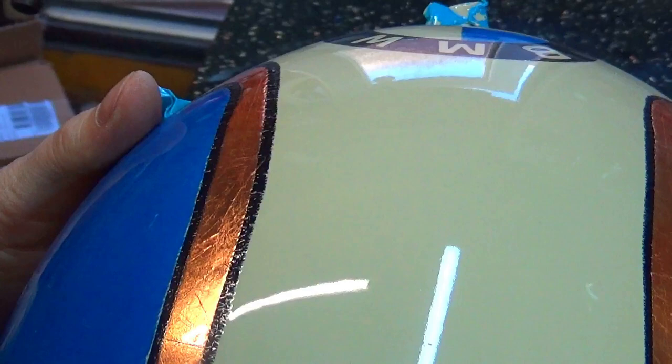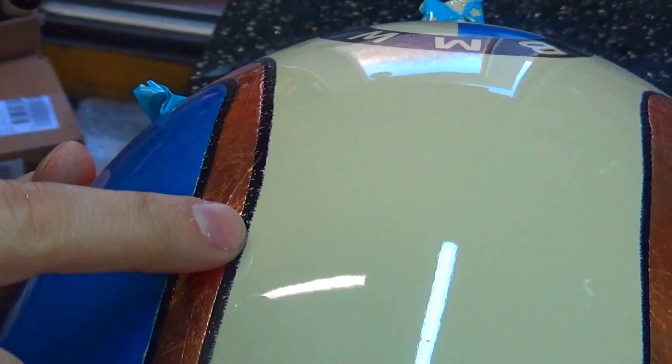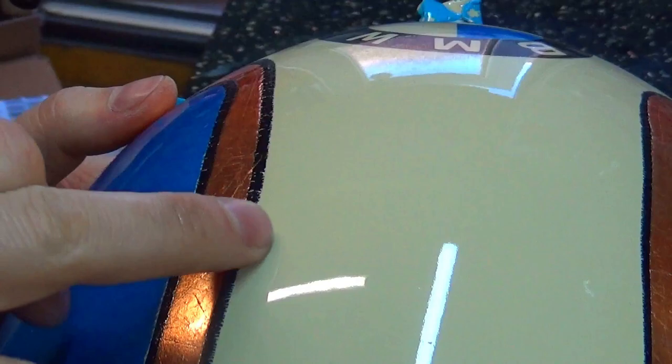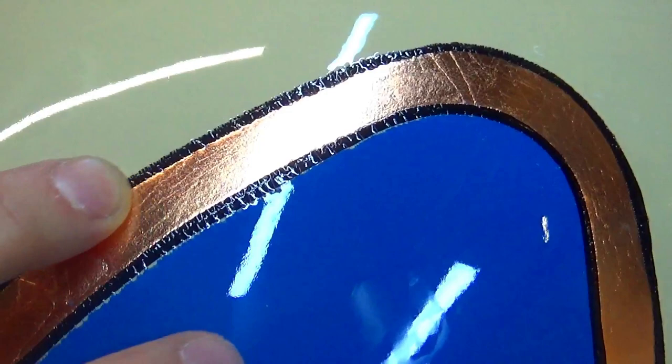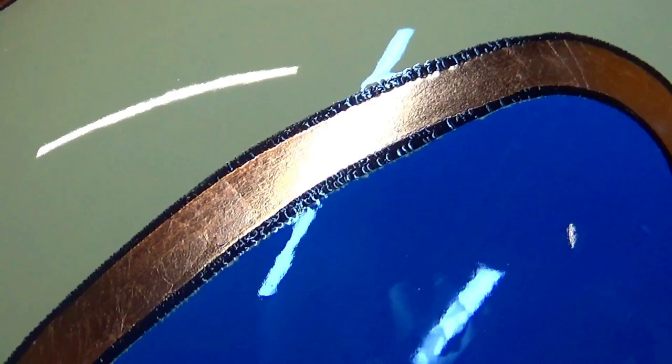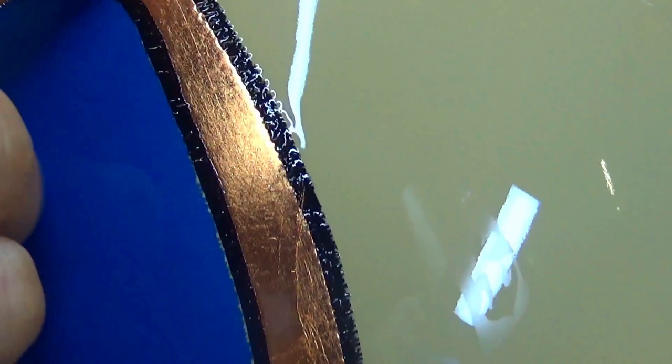See this? This is exactly the reason why you have to mix hardener with your enamel pinstriping paint before you want to clear coat it. Otherwise, it will wrinkle up. There's a chemical reaction. Enamel paint doesn't really like clear coat or the thinners, and generally they just don't mix very well. Obviously, there are ways of dealing with it. If you can't put hardener in for whatever reason, there are ways of doing it, but that's a story for a different episode. This, however, is the effect I was after, and I'm gonna show you why.